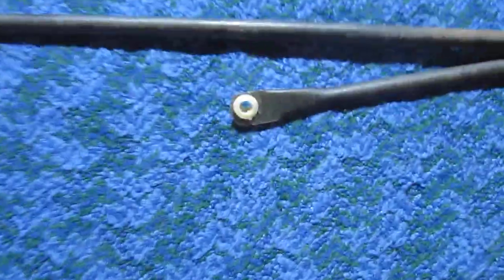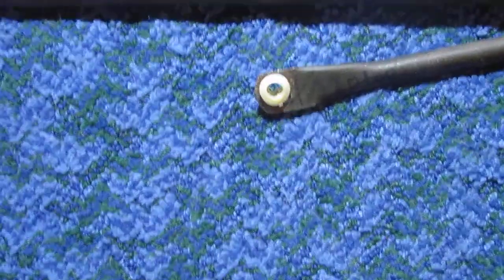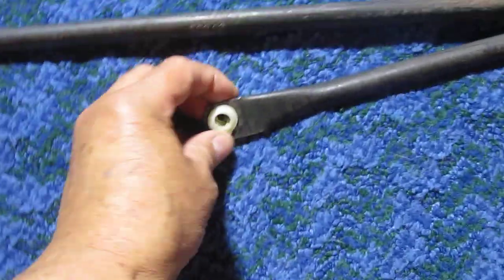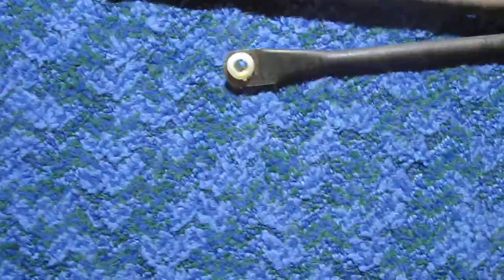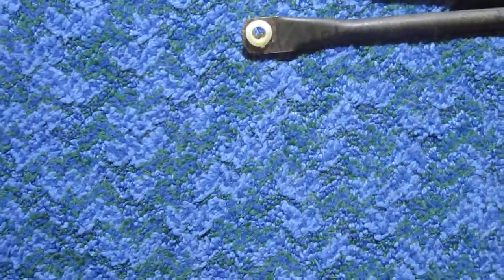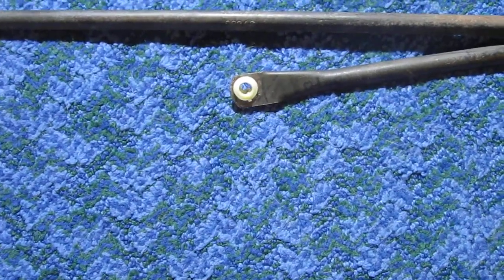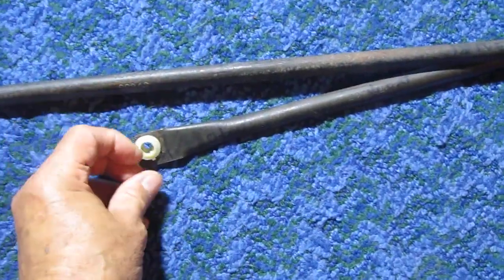Okay, going to the bushing itself. It's a hard bushing, and I tried to use a vise grip with a socket that fit right over, and try to press it in, and it would slip all over the place. The pin right here, you line it up, but I tried every which way with pliers, whatever, I couldn't get it in. Okay, so I ended up using a 1100 watt microwave, and 27 to 30 seconds I would heat this bushing up, and it gets pliable.